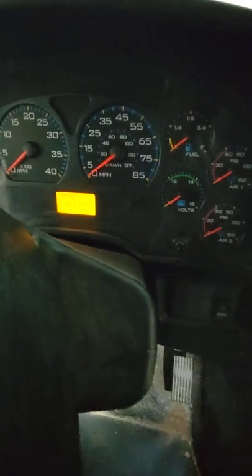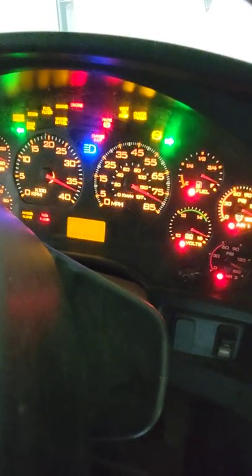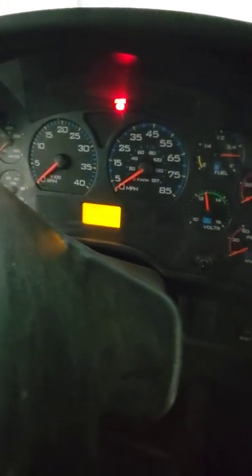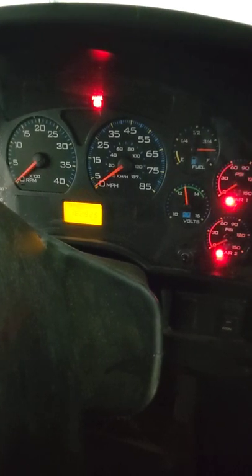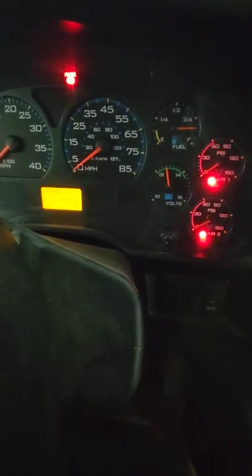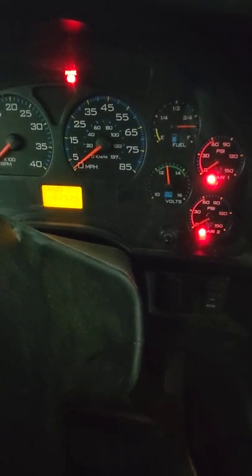I had to stop the video — when I first turned the key on, all the heaters were on so all we heard was the defroster pulling. We're going to try that again. The grid heater didn't actually run this time — the bus must be warm enough inside the shop. We didn't get that orange light, but you can see the voltmeter is up above 12. In cold conditions, that battery meter would be sitting at about 11 while the wait-to-start light was going. Listen for those noises: the loud click from the electrical panel solenoid, the injectors buzzing, and then the ABS noises.